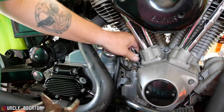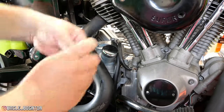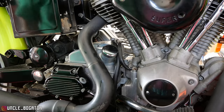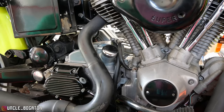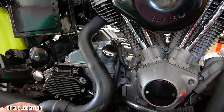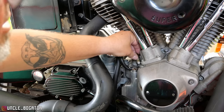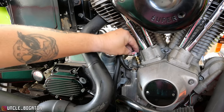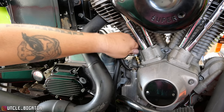This is the S&S brand switch. I thought — did I mar up the threads in there? Nope, goes in there just fine. We're gonna pipe-dope the end of that, just a hair. I've got the bigger kind you can brush on but this allows me to be a little more precise. I don't really want a whole lot on there. Start threading this in there. Okay, we're gonna put this 45 in here — I already put pipe dope off camera.